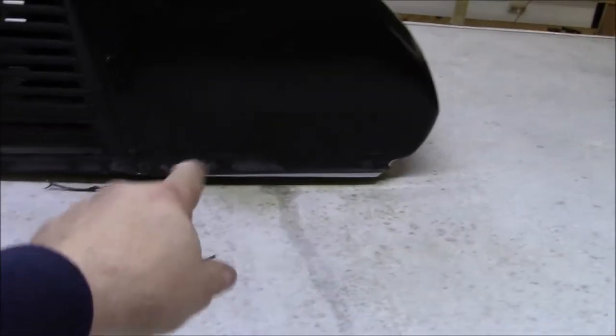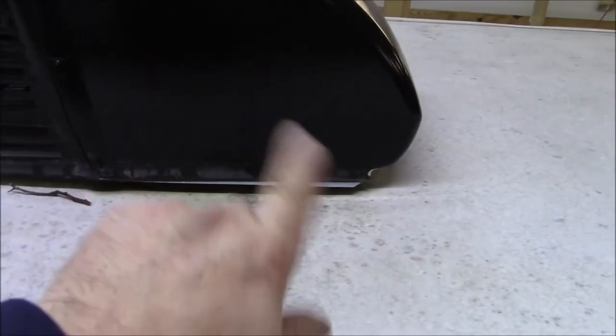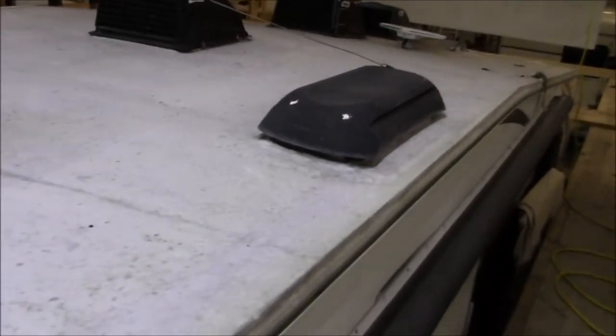There's a drain in there. If it doesn't find a place to drain, it will drain into the pan and leak back into the roof. You can see all this fracturing right here from condensation coming down and just standing there - that's pretty significant. All this discoloration just never looks well. But it's cheap - it's real cheap. The RV motto is: get them built, get them out, get them sold. They put this roof on in about 30 minutes.